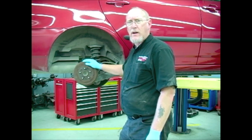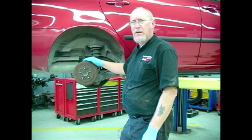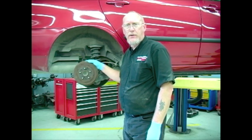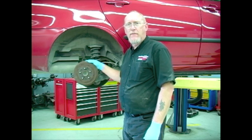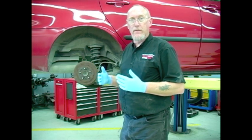If it's really stubborn — mainly if there's a lot of wear inside the drum and there's a little lip there — you may have to go in through the back and back off the adjuster so that you can remove the drum. But whatever method you need, make sure the drum is nice and free before you remove it from the car.